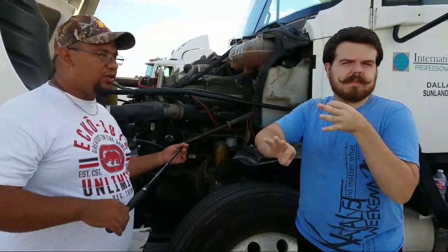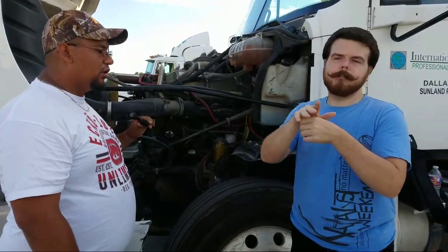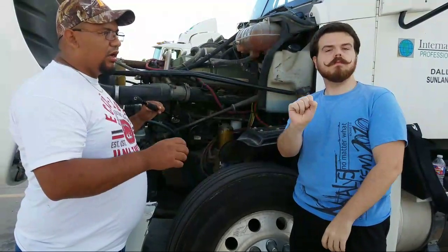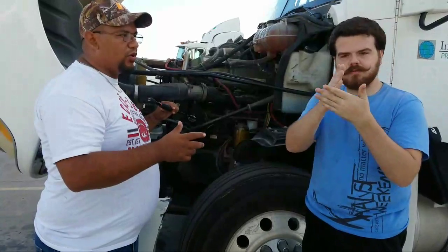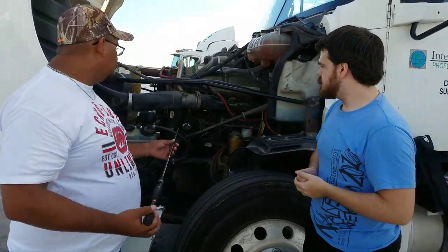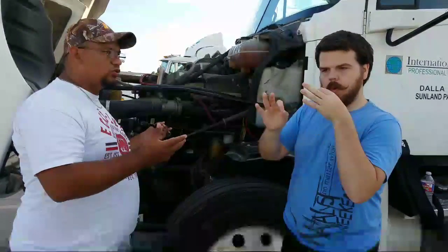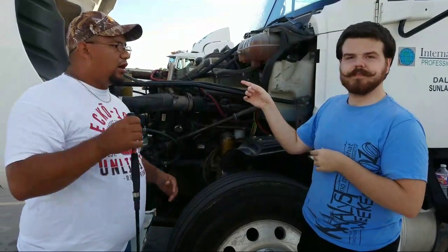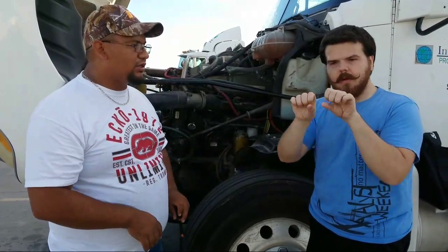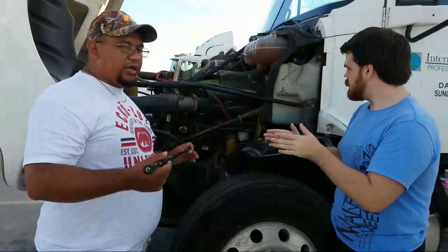They're simple things. I'm not going through them because they're like the engine oil fill cap and the engine oil dipstick. They must be checked for properly mounted, not cracked, bent, or broken, and it must be filled. The oil level must be above the level. Okay, so those things will be checked. On the air compressor, I didn't check the hoses, but like I said, all the hoses, like I inspected them on the radiator, must be checked the exact same way. Must be properly mounted, not cracked, not bent, not broken, no leaks, and that's it. From there, guys, we will go to our steering components.